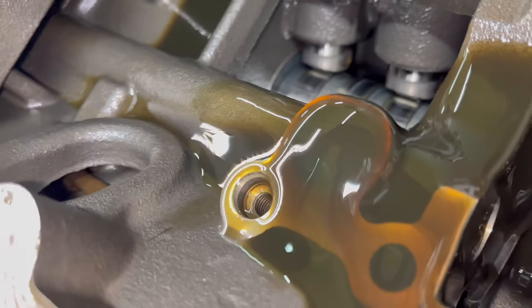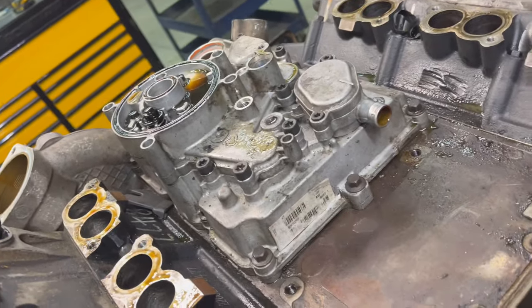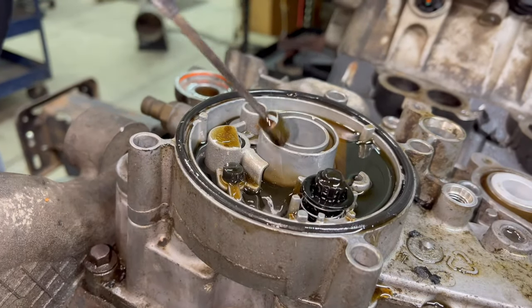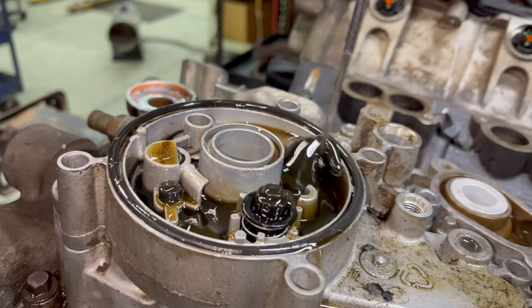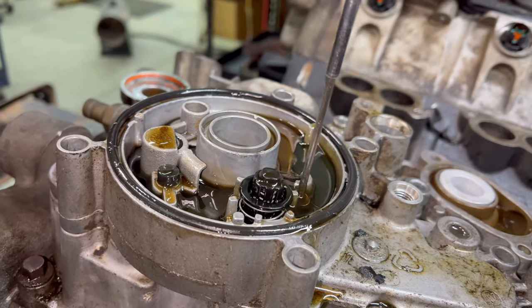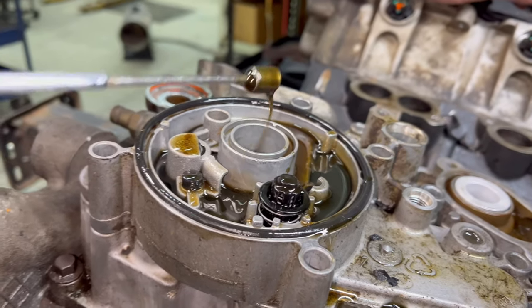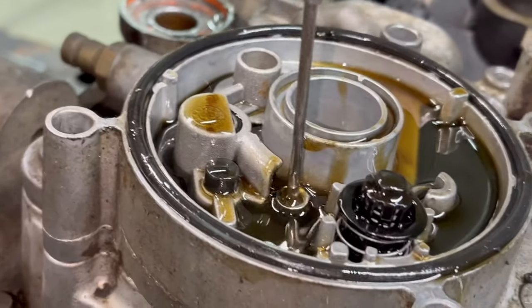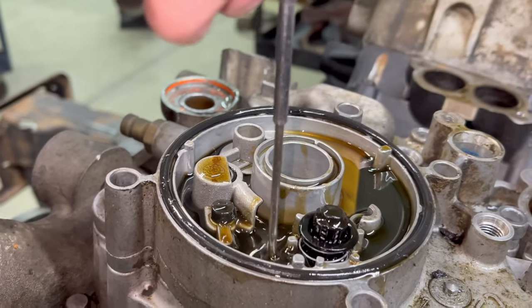Oil doesn't look half bad. Pull your pump out first and it drains the reservoir for the oil cooler — so always do your pump first. This is where you stick the pencil magnet down in right here, almost every oil change. You do that, you will be paying attention to any metal that's in your truck. This is the low point right here — there will be metal in here if you've got a failure.